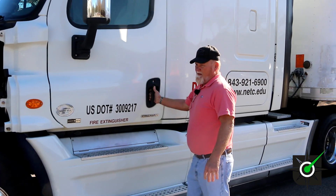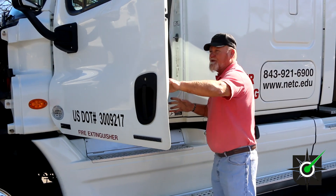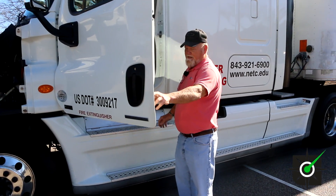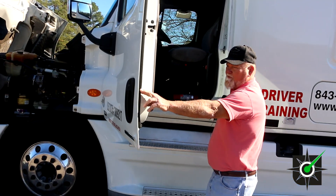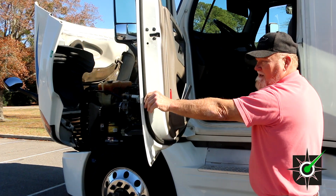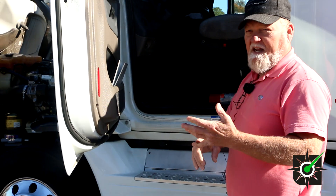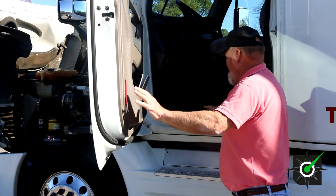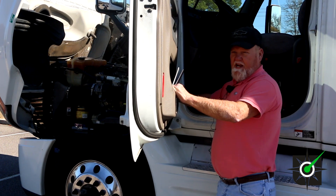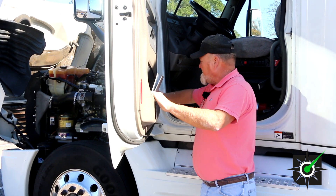We have our door lock — the door lock works, it's properly mounted and secure. The door opens and closes properly. We have a rubber seal around this door, inside the cab and on the inside of the door. It's a rubber seal, so it can't have any abrasions, bulges, and cuts — anything that's rubber is ABC, so that makes it easy for you to remember. The seals are properly mounted and secured with no cuts and abrasions. The door is bolted on with hinges — the hinges are properly mounted and secure, bolted on with bolts, and the bolts are present and tight.